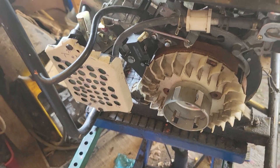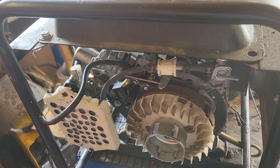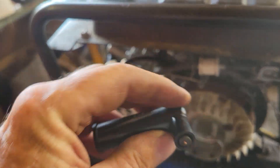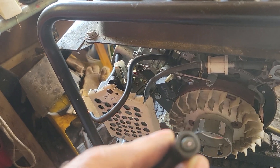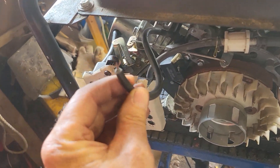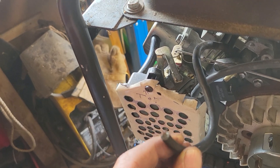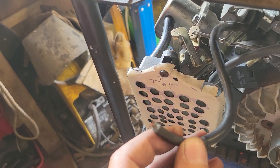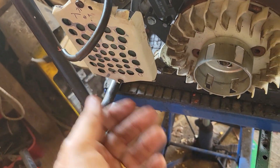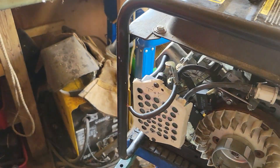Then I thought — I had a Honda one time where this part went bad. I realized I could turn this on the cable, so I snapped it off, as you can see. Now I have the bare wire there and I don't have infinite resistance on that wire anymore. When I put the spark tester on it and turn it over, I have a spark.